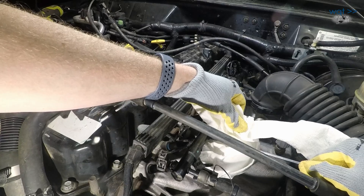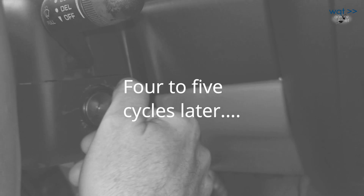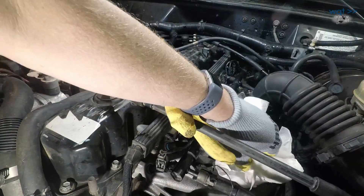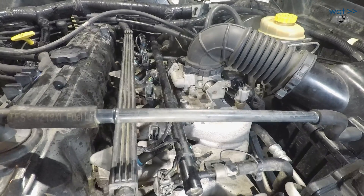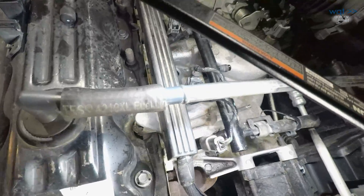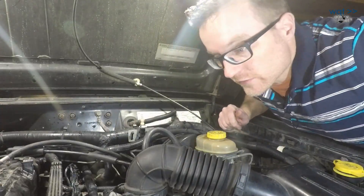Okay, we're pumping some air out. Got fuel — we're primed. Is it running down any injectors? So far, no. We reprimed the rail, so I'm going to turn it over a few times. That started up nice and quick. Did anything leak? Injector one — clean. Injector two — looks clean. Three, four, five, and six. Not smelling any gasoline under here, so hopefully that's good news.